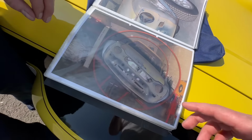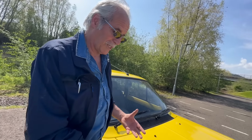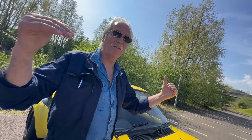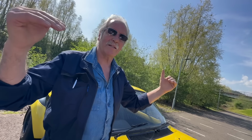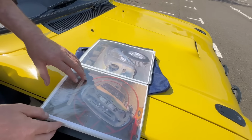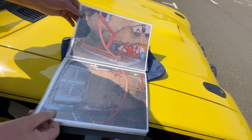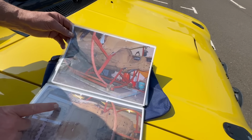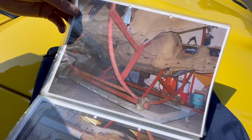And you were saying you made this jig? Yeah, I made the rollover jig. Again, it's purpose built. I actually built the Mexico in that as well because I hate spits. Spits put too much pressure on a vulnerable shell. When you're putting sills and floor pans in, they can bend and make your door gaps terrible. So I made up a big roller system, and it just spun round on the made up rollers. You just hand pulled it round, and the weight of the car just kept it wherever you needed it to be. So that was a godsend.